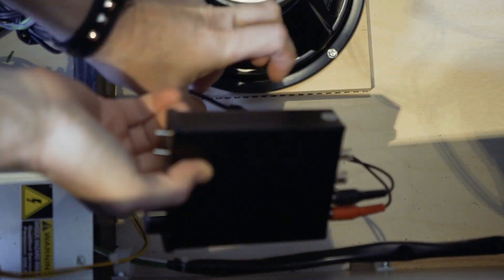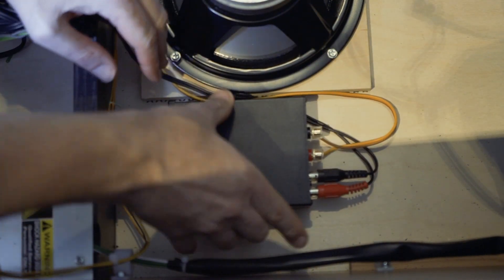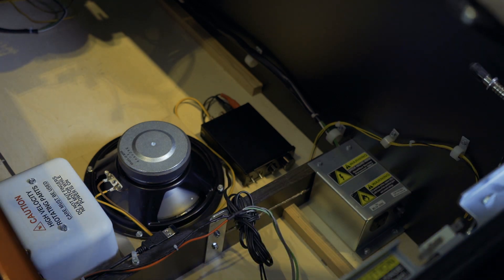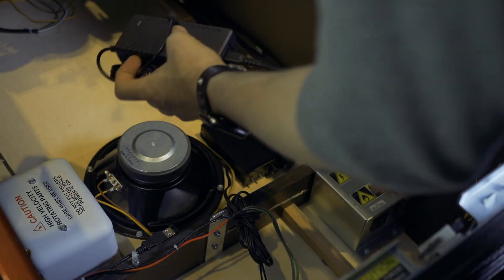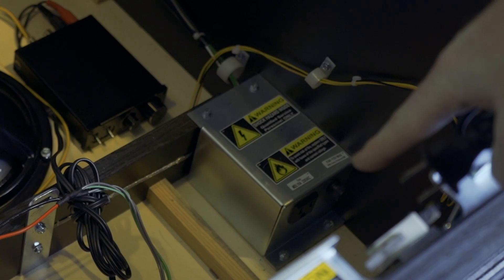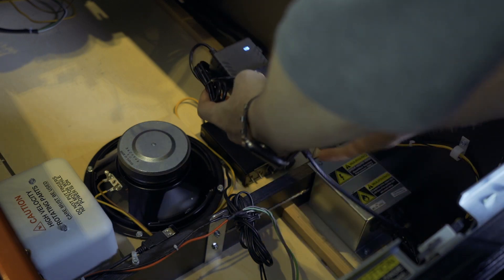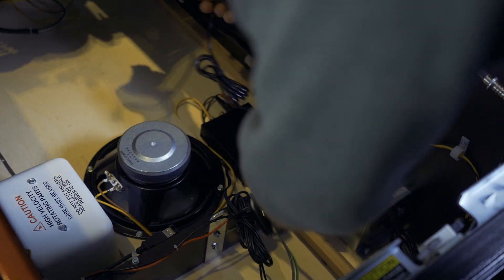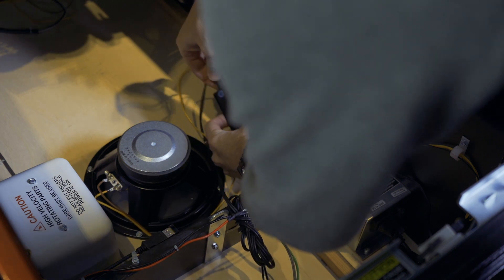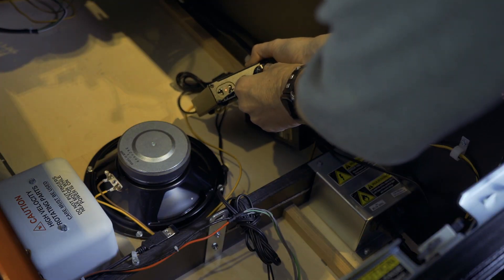What I had planned to do is put a little piece of Velcro right here, and the amp would live about right there in the game — nice and tucked in out of the way. The last thing is to install the power supply to the service port. Most games have service ports located right there — it's just a plug outlet. Plug that in, you'll see it lights up, plug this in, and that is it. Speaker is active.